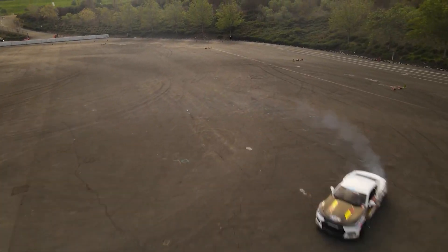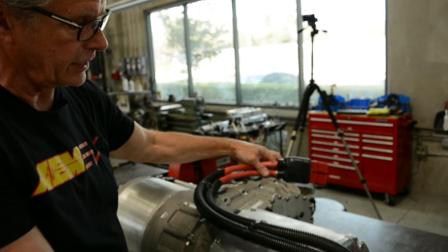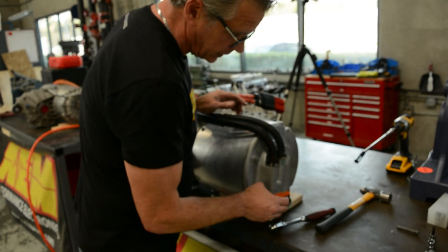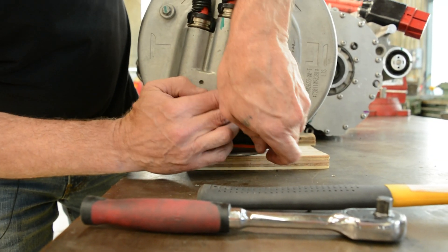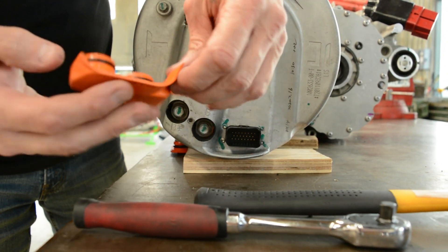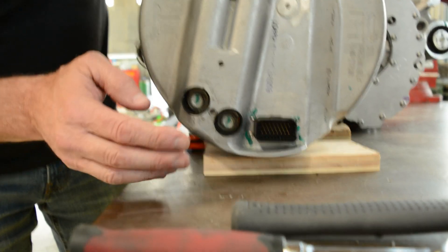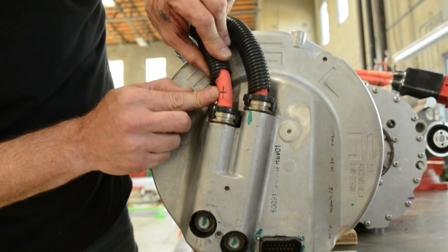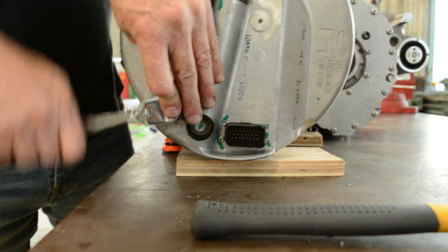Because this is coming out of the race car, the drift car, it actually has a quick disconnect for your DC voltage coming into the inverter case. So that's different cabling than it came with from the factory. We're going to pull the end cover off here, just below this cap. You want to be careful with all this stuff that you don't break the plastic, because everything's O-ring. You'll see a B-plus and a B-minus — so that's your positive and negative. I like to add a Sharpie indicator on top, both sides, positive and negative, and I do the same thing at the plug-in. It just simplifies things and makes sure you're not going to make any errors.